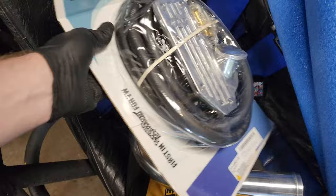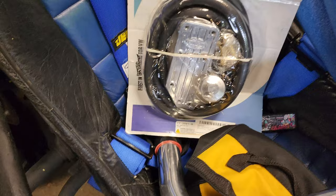But in the meantime, I've been talking about this oil leak forever, and I've got a lot of crankcase pressure. So let's be honest, this engine's a little tired. So instead of fixing the problem, we're just going to keep throwing band-aids on it. I have acquired one of these EMPI oil fill breather tower doohickeys, and we are going to get that set up.